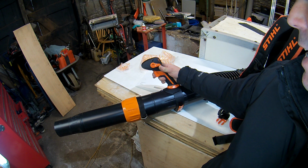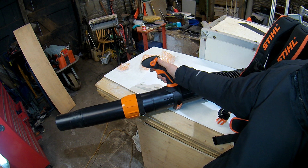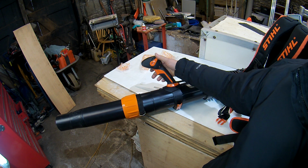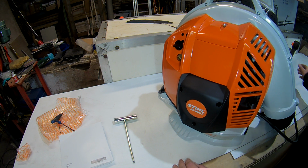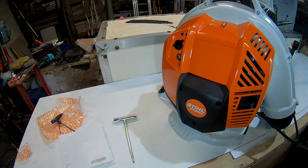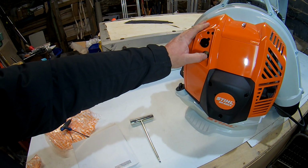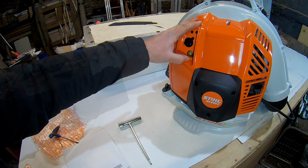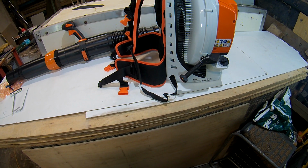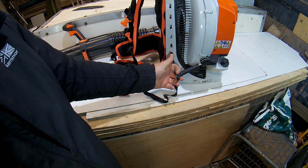Then up is your throttle, your cruise control as such, on the lever. So full choke, and then once you press the throttle, once it's started up, it shuts off. So choke's off then. Once you put the fuel in now, we'll pump the primer bulb 6 times, and that's a way to go.